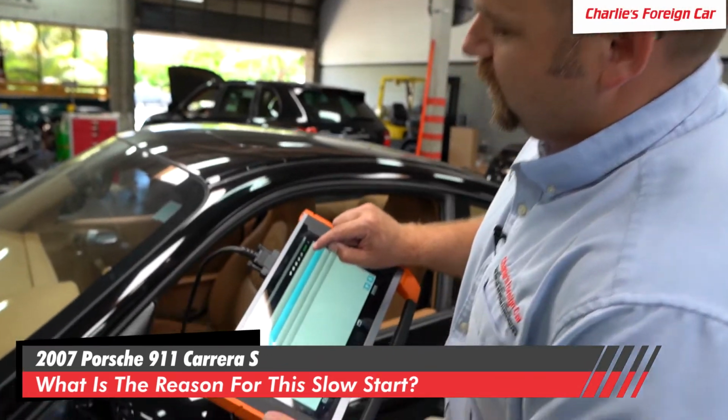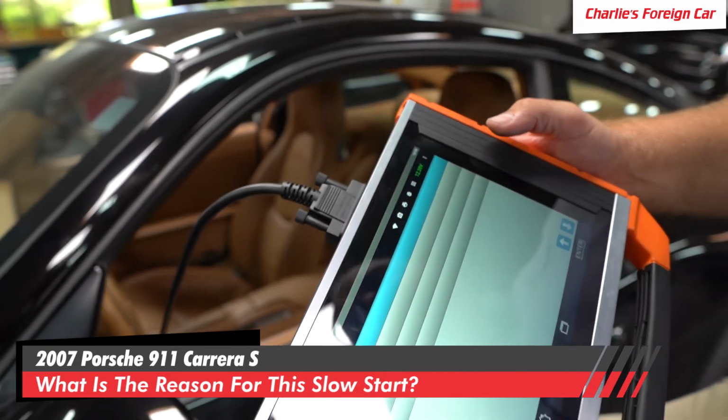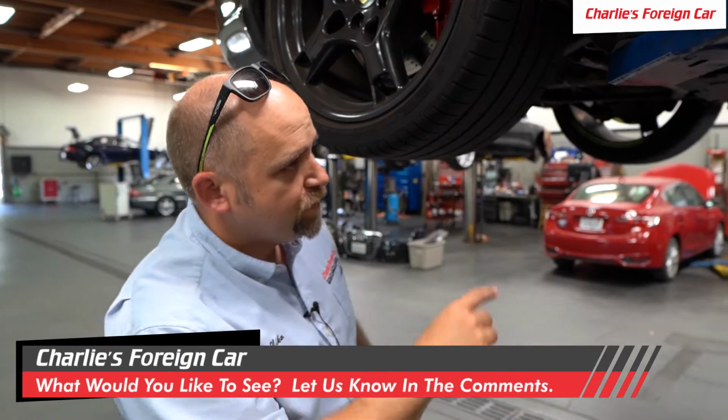First thing I saw is that our voltage while running is 12.35 volts. This is very low. This is too low. We are gonna follow the starter cable, the positive battery cable from the battery to the car.